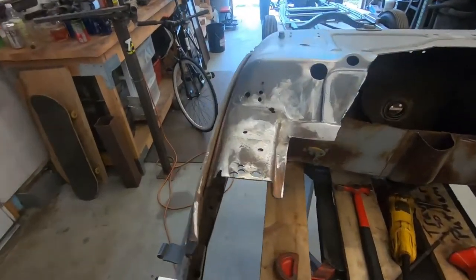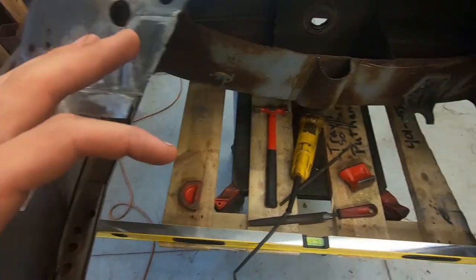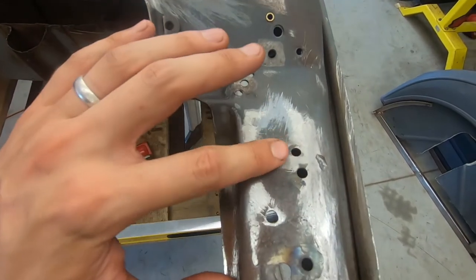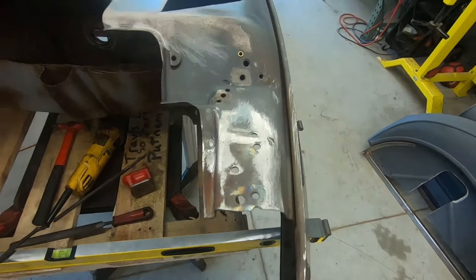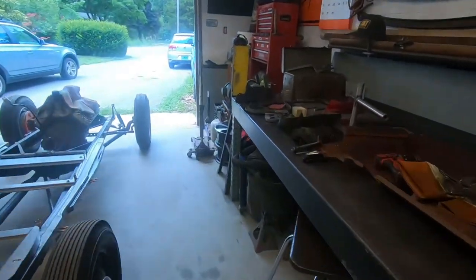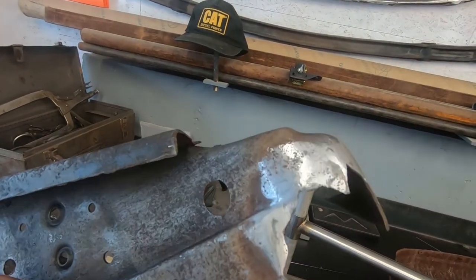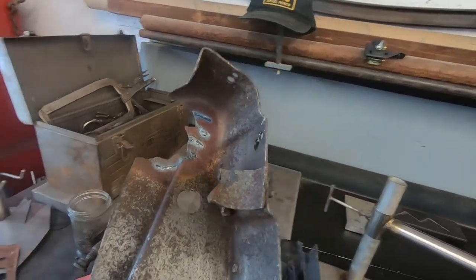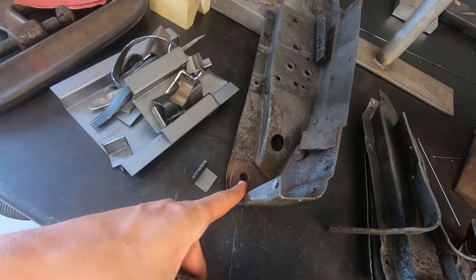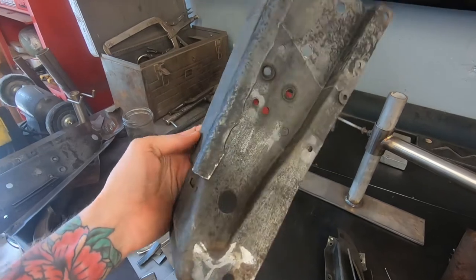I've been filing on those little patches I made on the firewall. Here they are — this piece right here and this piece right here. Going to file down that high spot. Other than that, it's coming out pretty good. Then I just need to fix that piece. I welded up all the cracks, filed down the back side. I'm going to make a template out of this one, then fix this one. Clean these up, primer the back side — primer pretty much everything.